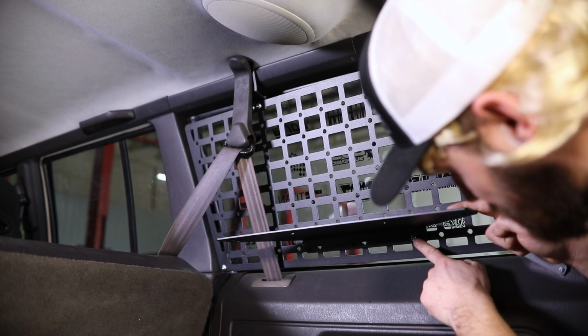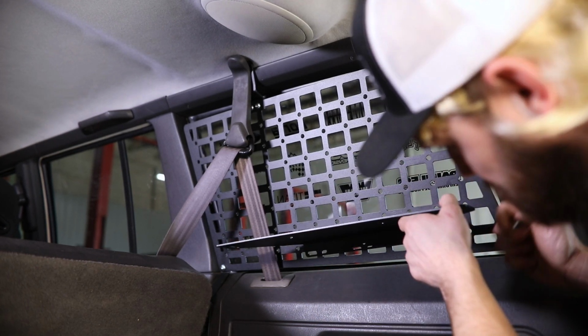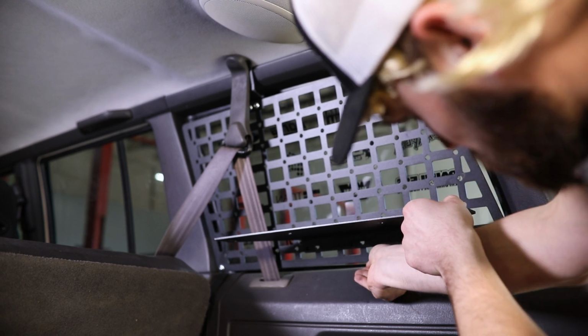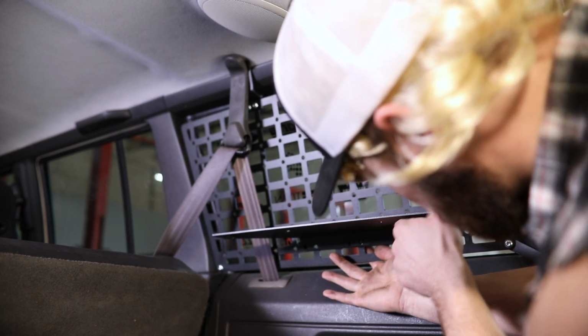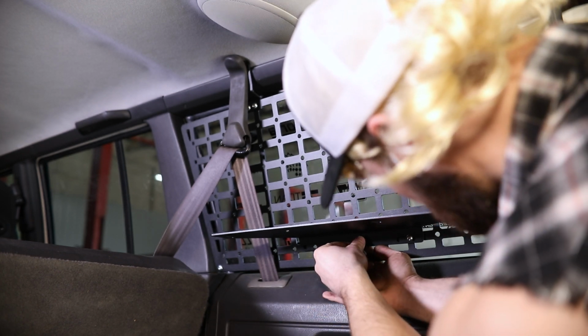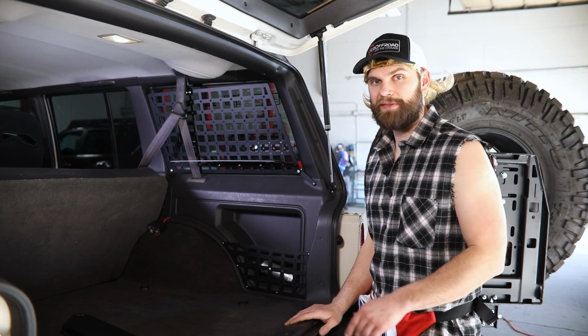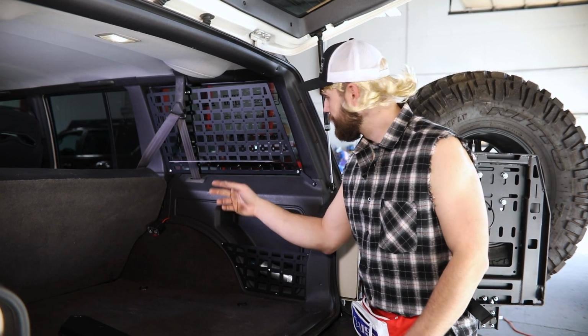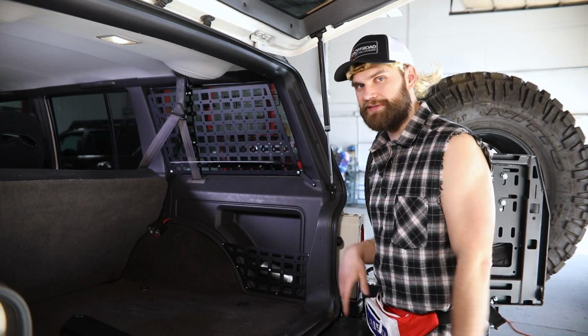All right, so now that you got this rear bolt loosely installed, it's gonna be easy to see which 2 bolt holes these other slots line up with. Then you just do the same thing here. Slide a nut in from the back side, and then loosely install your bolt. All right, so with these 3 in place, we can go ahead and do the same thing on the other side. Just note that we're gonna leave those a little bit loose for now, just kind of finger tight till we get everything assembled.